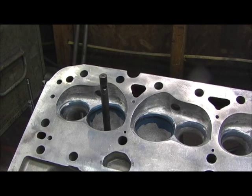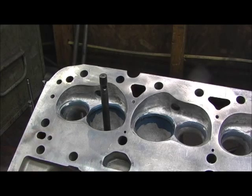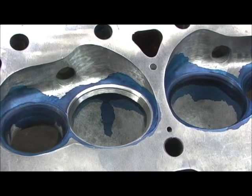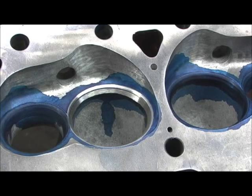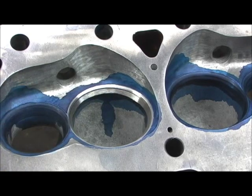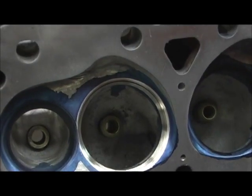What would 20 thousandths diameter do for airflow? Probably not too much. But it's the seat work that matters. My valve jobs are going to be a four-angle cut deal, and I'll make it so it can make the 90-degree turn and dump the air better into the bore — mainly on the intake — by using the 2.100 valve. So I'm going to set this up and get the valve job done, then we'll look at the bowls. Around the 5,000–6,000 RPM side, I keep my pilots new and replace my stone holders once a year so it's tight. Look how thick my blue line is right here — now look what happens when I turn it.